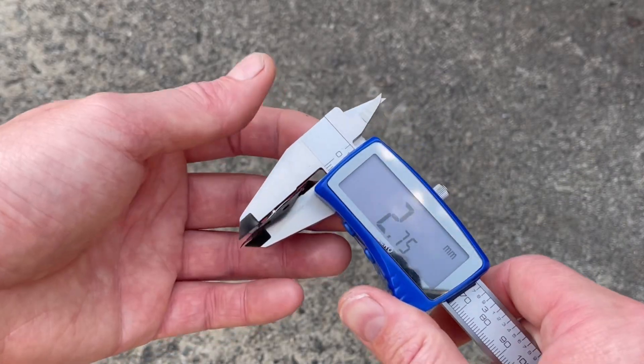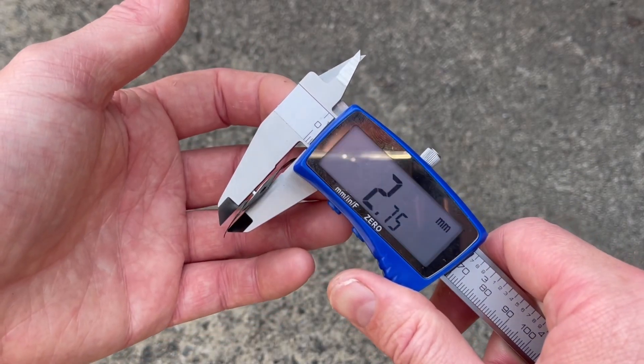You can use your vernier calipers to determine the nipple height and match it up to the one you've removed. It's much better to use the right diaphragm, but knowing ways around obstacles is always handy and it can get you out of a pinch.